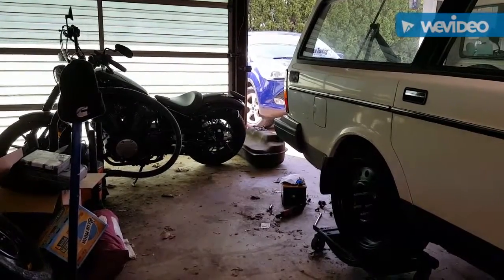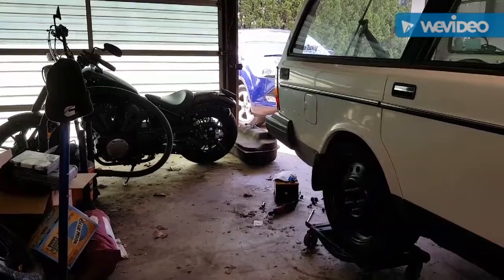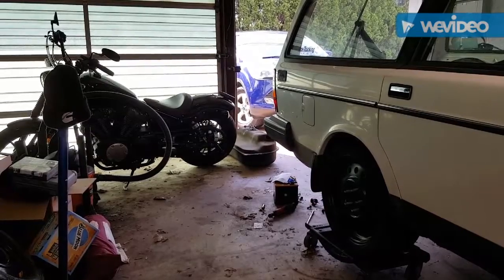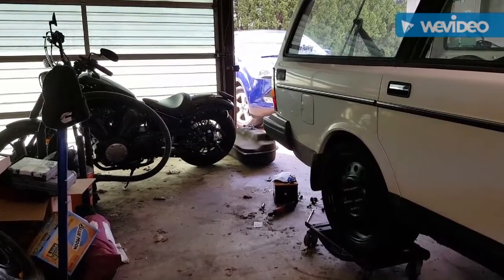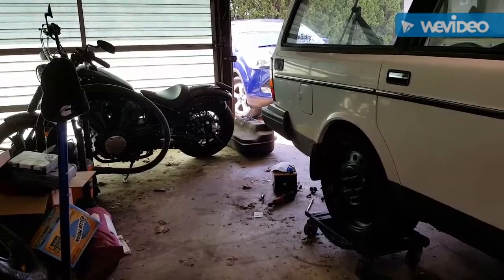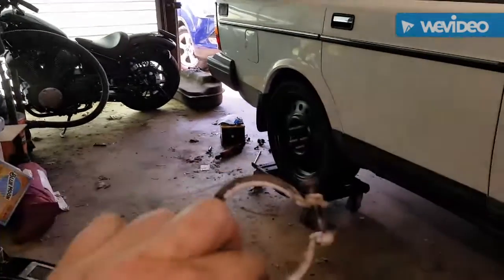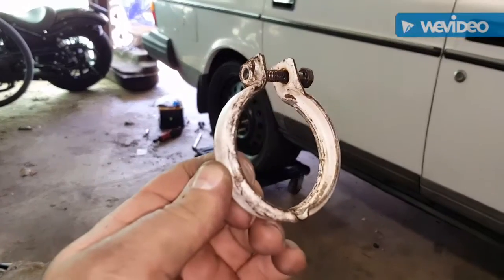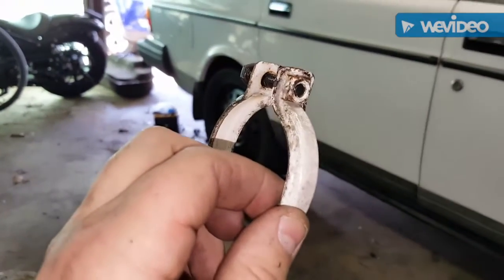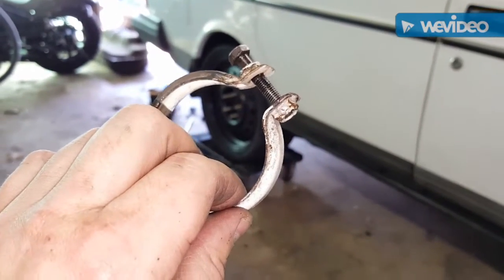So basically, you have the aluminum filler neck that comes down through the car and routes its way down underneath where the gas tank goes. Well, there's no rubber hoses or hose clamps involved at all. The metal rigid part of the filler neck actually slips inside the gas tank through the fill hole, and you use this clamp, which is almost like one of the clamps you'd find on a wastegate V-band setup. I'm not sure why they took the time to paint it the same color as the car, but I guess maybe their attention to detail is what makes them Volvo.